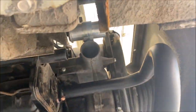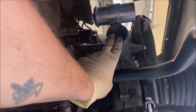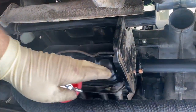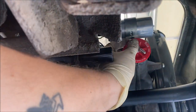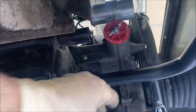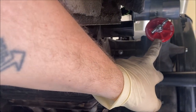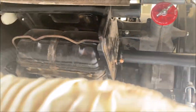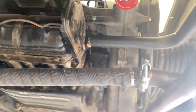You may have noticed in the unboxing video there were these weird little plugs. Once we removed all of the heater boxes, the cooling fan for the engine is all open - if you leave this open, all the air that should be running across the heads and cylinders cooling the engine is just going to pour out the side and not do any good. These plugs from ISP West just pop right into that hole, you screw the wing nut down tight, it expands and you're good to go. ISP West has always been awesome to me - every question I've ever had they've answered, and I don't feel bad about paying a couple extra dollars for parts from somebody that's helped me out that much.